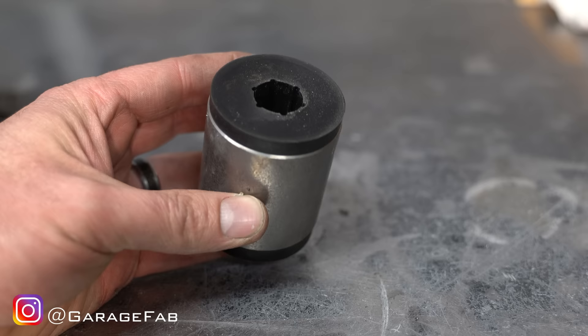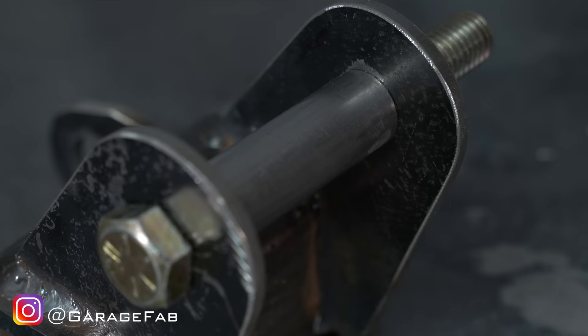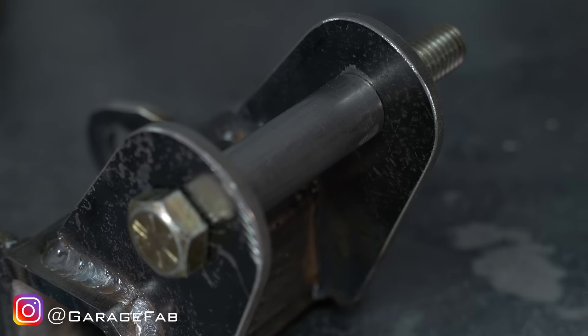"Hey, the tabs aren't part of a bushing." Oh yeah? Well, you, my friend, might be building your bushings wrong. I like to think of bushings as two separate assemblies, and I think you should too. You have the suspension component side, which has the bushing material and the outer sleeve, and the chassis side, which consists of the tabs, the bolt, and the inner sleeve. When properly made and properly assembled, the chassis side parts make one solid piece. There are no moving parts.